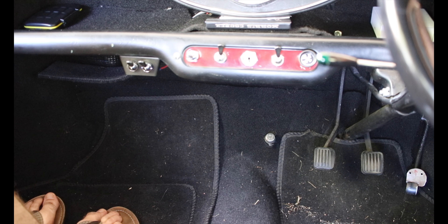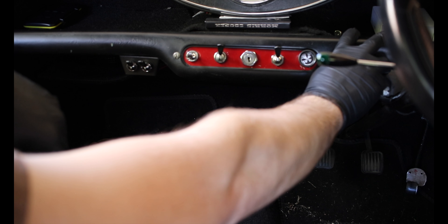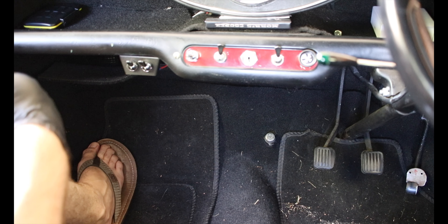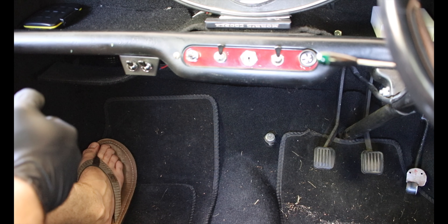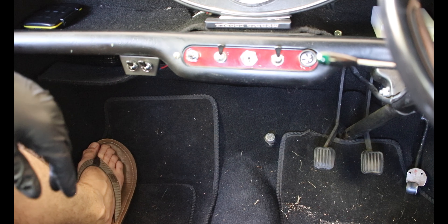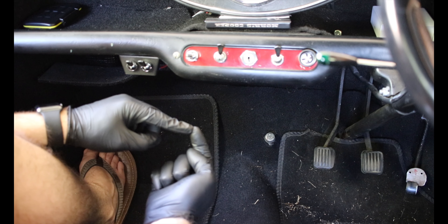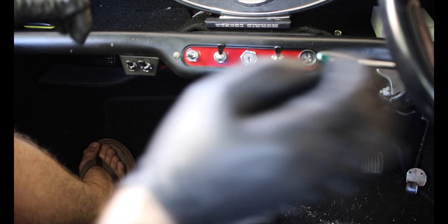Now it's time for the in-car stuff. First, let's take a look at the way the steering wheel mounts in the car already. What you have is a bracket that mounts it to your dash right here, and this bracket can sometimes be extended downwards if you want the steering wheel to sit lower. Some people add those, and if you don't have one and feel like you need one, I did put a link below. Sometimes people who are taller feel that's easier, though personally I think it's easier to have it higher. Your steering column comes right down, goes through your carpet, and mounts to a splined connector that clamps around it — that's what allows you to turn the steering wheel and make your wheels turn.